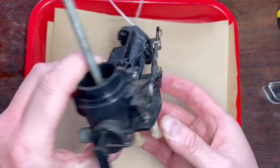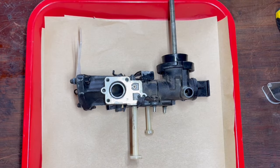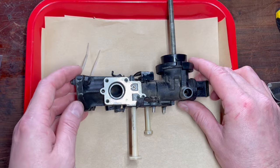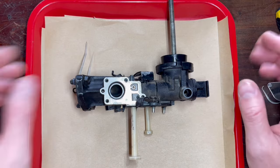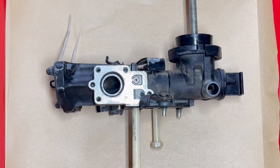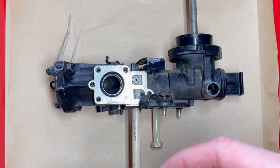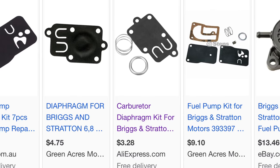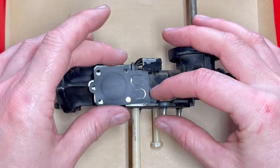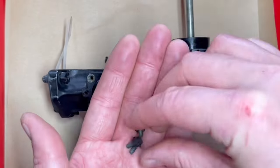So all the passages have been cleaned out now and it's time for reassembly — it's so quick and so easy. The only thing I'm going to put in is a new fuel pump diaphragm. The gasket here is great. The gasket that connects to the cylinder head is great as well, there's no need to change anything. This seal is good as well, this little washer — so we're going to leave it well alone. All we have to do is place the spring back in on the fuel pump, then this little keeper. Again, these come in the kit, so if you buy the whole complete kit you can just replace those if you so wish. Fuel pump diaphragm can only go on one way — it's back in like so. Cover goes back on — they've got little alignment pins. The four screws go back in place.